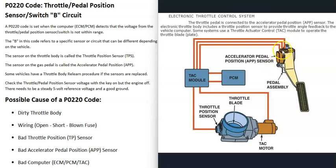In the electronic throttle control system, there's a sensor down on the gas pedal reporting to the computer how far down the pedal is pressed. This computer can be called a throttle actuator control module, or it may be built into the PCM — the powertrain control module. At the throttle body, there's a small DC motor that opens and shuts the plate depending on the voltage going to it, and a throttle position sensor that reports back to the computer how open that plate is.